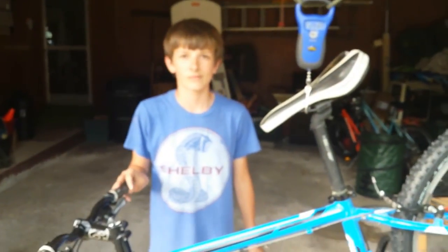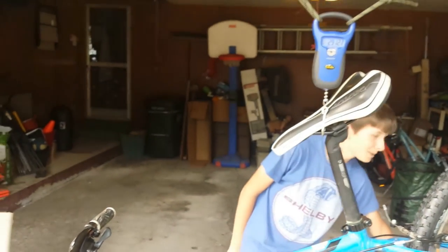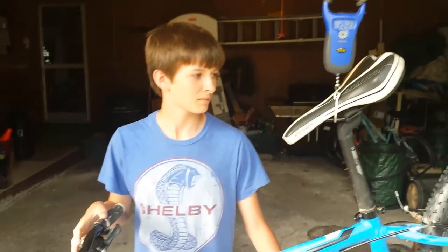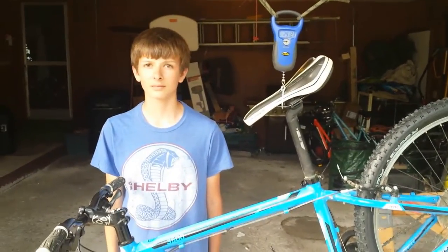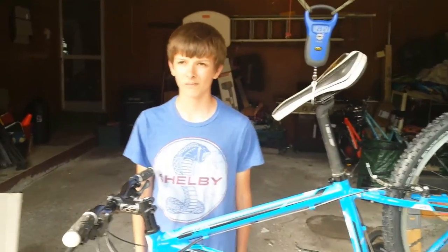Lennon, can you say a few words about the bike being lighter and why you want it lighter? Well, I want the bike lighter so it's a little bit easier to go up hills, and a lot of the kids I race against have much lighter bikes and I just wanted a bike I can compete with. Yeah, we can't quite afford those expensive bikes the other kids ride. The big thing about wheels is what we call rotational mass — if you know physics, you want the outside of the tire to be very light because the less rotational mass you have, the quicker the wheel will turn.